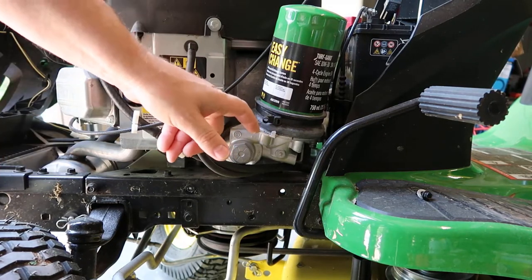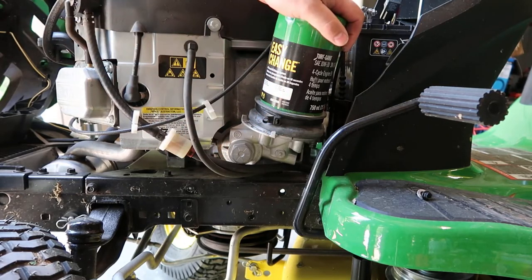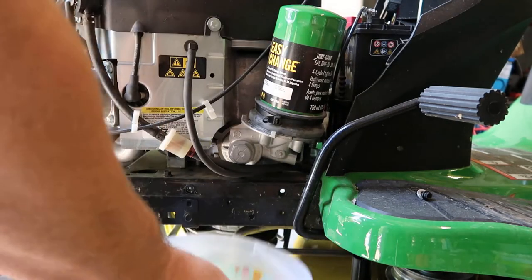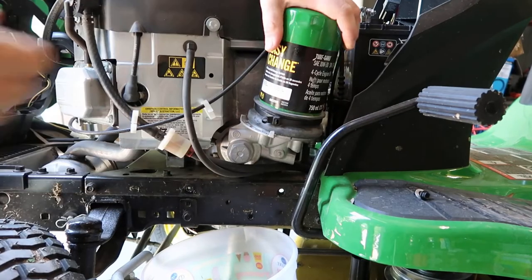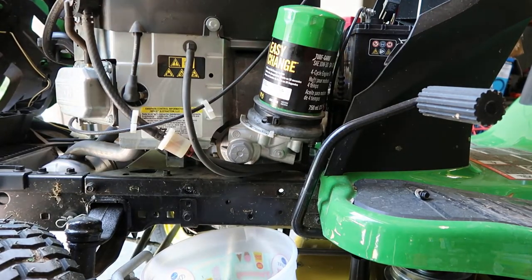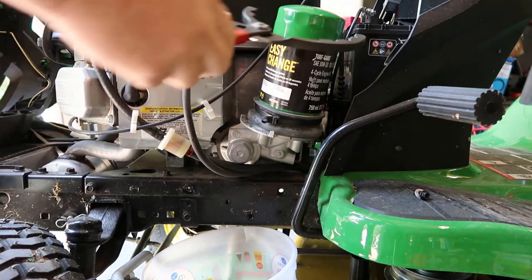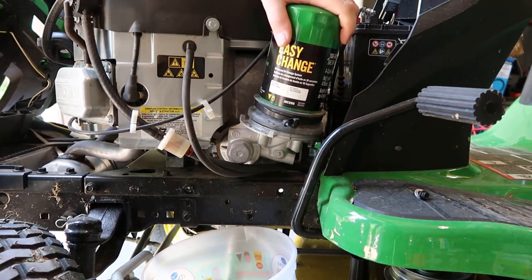Right here it shows the illustration to take it off — to unlock it you've got to twist it counterclockwise. So that's what we're going to do. Got me a little ice cream bucket right here. Oil came out. Let me get the pliers — take that off because it's too tight to take off with my hands. I like this oil filter wrench here, it's just adjustable. But you can use any kind of oil filter wrench that'll fit it. Let's break that loose there.